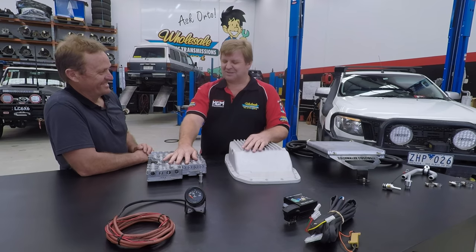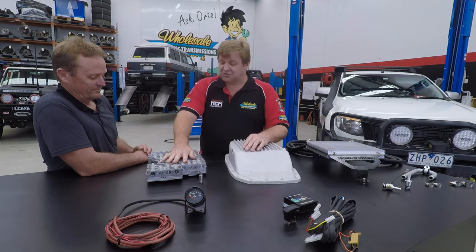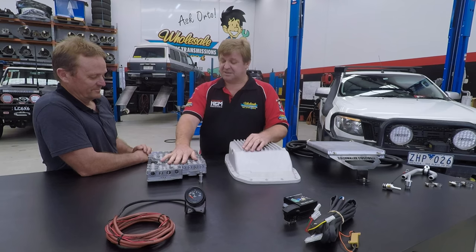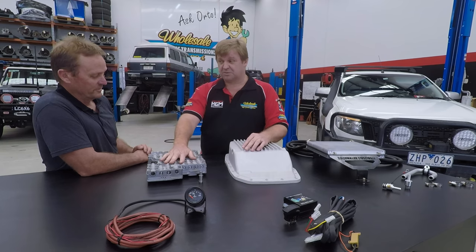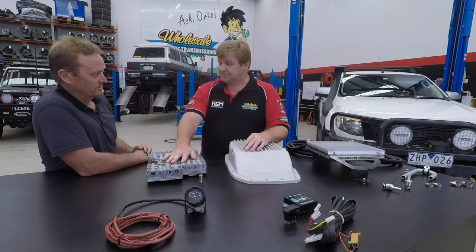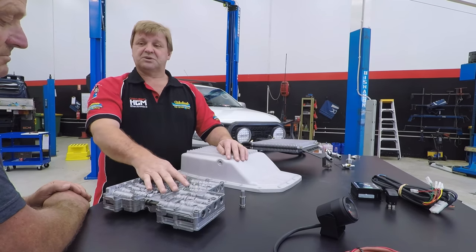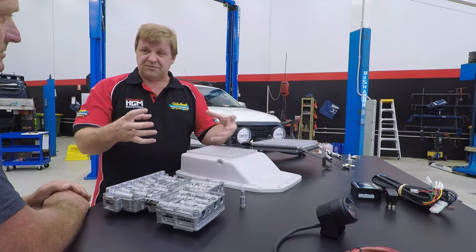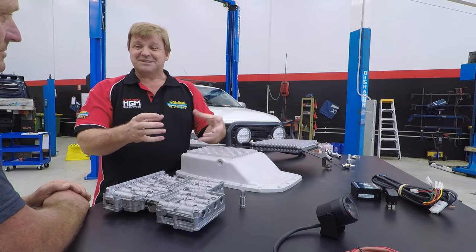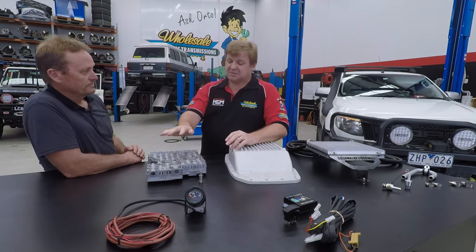The last one is the Nomad valve body — it's new for the Ford Ranger, though we've been building Nomad valve bodies for eons for most makes and models: all the Toyotas, Nissans, D-Maxes, and many more. We've now mastered the Ford Ranger and BT-50, covering all six-speed models. It does several things: it gives one litre per hundred better fuel economy all the time regardless of towing, and keeps the transmission cooler by pumping more pressure into the torque converter. Increasing pressure inside a captive vessel changes the oil viscosity slightly — it gets thicker, slips less, generates less heat, and that's how you get better fuel economy.